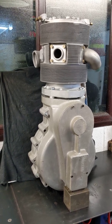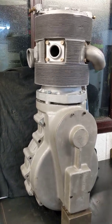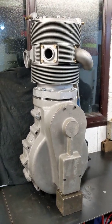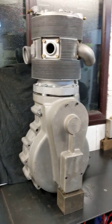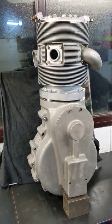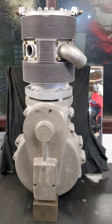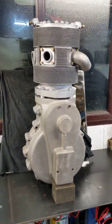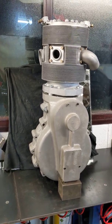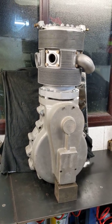What I have done is bolt the spare timing cover to the spare engine cases, bolt those together, make some space so I can bolt the spare barrel to it — and I've now got a complete engine assembly. There are no internal components to this, but it does give the opportunity to see the kind of size of the thing, and to get it down to the frame builders to give them the opportunity to start making a frame and thinking about what's going to look right in terms of the lines, what sort of angle the engine is going to be leant at, and whether the engine is a stressed member or not. Once I can give the frame builders a full-size mock-up, it gives them a chance to start looking at that.